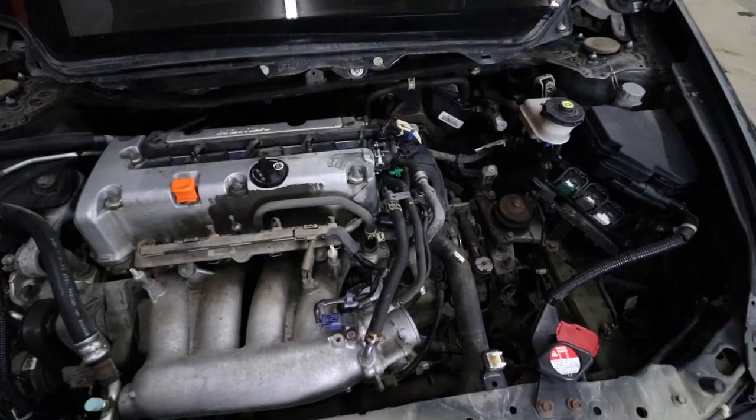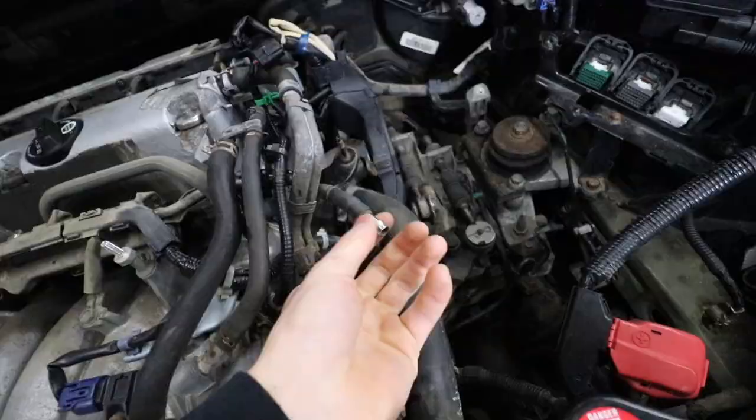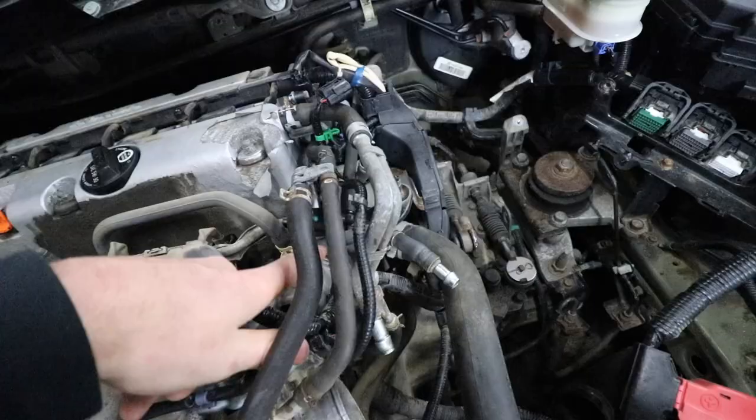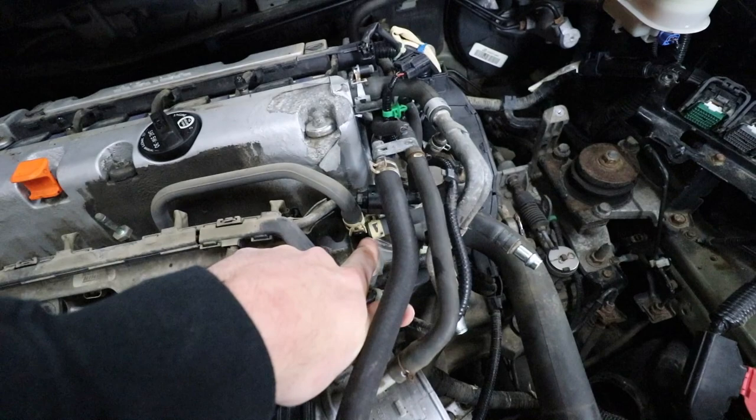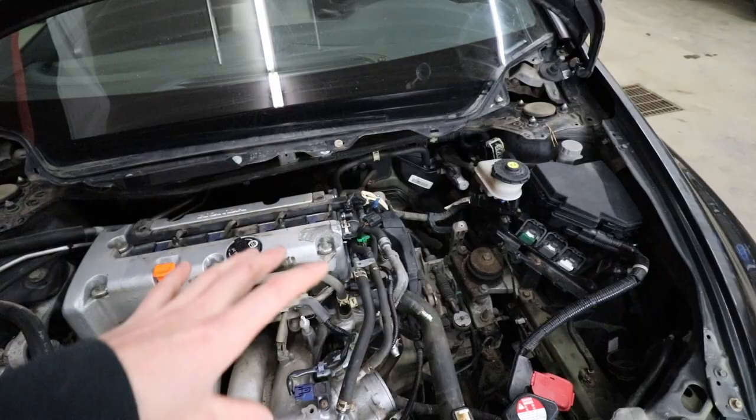On the Civics, it looks pretty similar to the Subaru — you have your PCV here, one vent that goes to the crankcase, and then this one on the side goes to your intake, as does the port from your valve cover breather. For the valve cover breather you could either loop it straight to the fitting that goes to the PCV, or put a breather tube on there and block that one off. You just need some way to equalize pressure from the head to the crankcase — we'll figure it out when we get there.